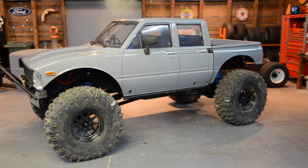The motor we took out was a 35 turn, but those just standard can motors that come from RC4wd in the regular runs, you just can't compete with these Holmes Hobby motors. So that really changed the driving characteristics. The low end of the speed is just so smooth. This thing just glides over, and you still have that top end punch. The top end speed wasn't quite there, but we've got the crawling speed that we need, and it was very, very much improved.